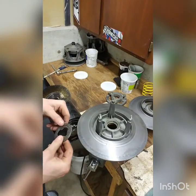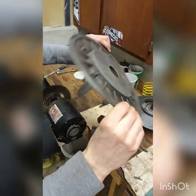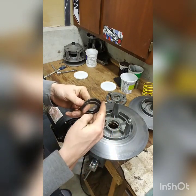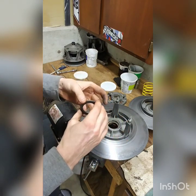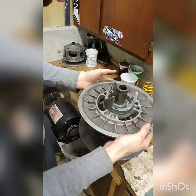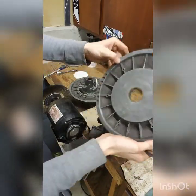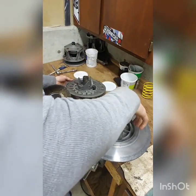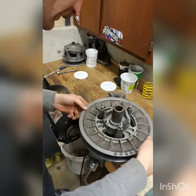So to put this thing back together, remember the washers we took out when we tore it apart. We'll lay down our moveable sheave, lay down those washers. I'm putting the same amount of washers back in that we took out — I'll show adjustments in a different video. As I mentioned, the number of washers depends on your belt deflection. Take our stationary sheave — remember to check those timing marks and put the sheaves back together in the same direction. Find the top one, put the shims back down, and slide it together just like that.